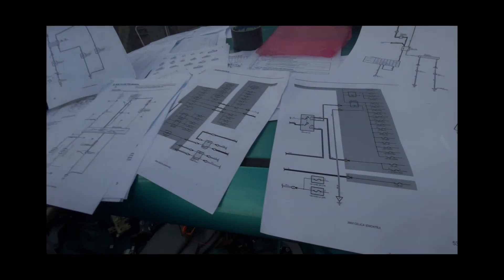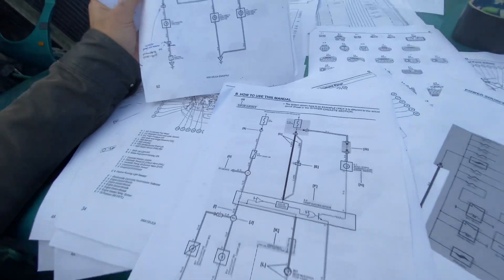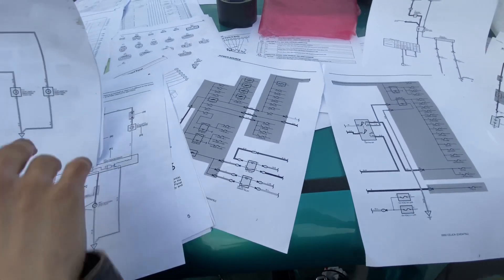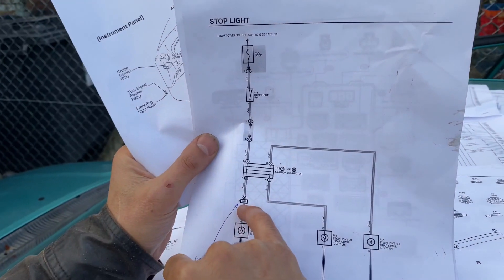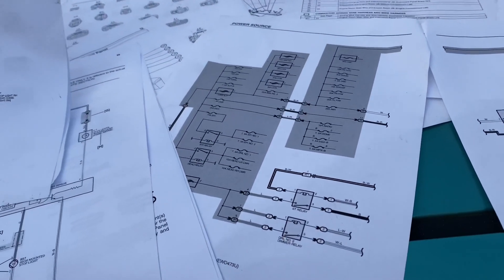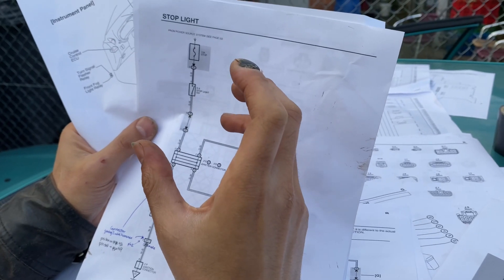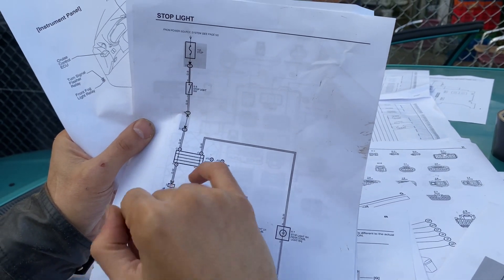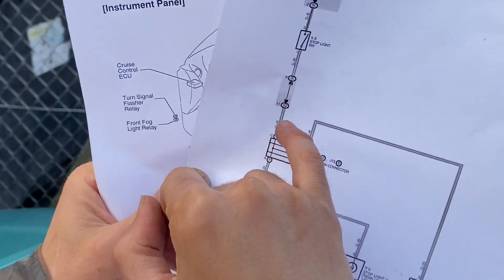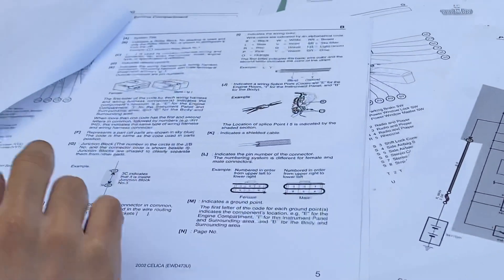Let me take you back one step to show you how I'm learning to use this manual. If you go inside, it explains what all of these symbols mean on the electrical diagrams. If you don't have this it's confusing — you've got these square empty rectangles, oval gray rectangles, oval plain rectangles. It turns out each of these represents a different physical connection. That square by itself is a connector which connects two wire harnesses together. The gray oval ones are junction boxes.